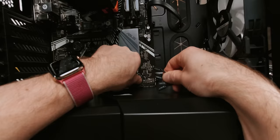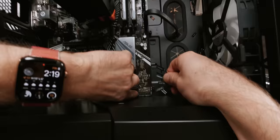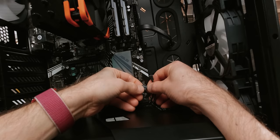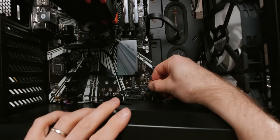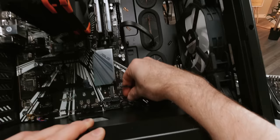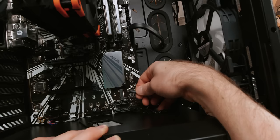So here we can do our hard drive LED, which you can see is the bottom left one first. Positive pin, swoop, to the left. Next up is our power LED. On many cases, these will be separated into individual pins because some motherboards have them right next to each other while others have a gap. This board actually has both options — you can either put them right next to each other here or have a gap there. I tend to just put them right above my hard drive LED. Now our reset switch goes on the bottom right next to our hard drive LED. This one doesn't have a positive wire indicated — that's because it doesn't matter, it's just going to short those two wires. Same with the power switch, which goes right above that.